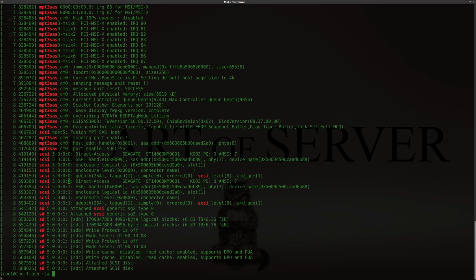And so this last number in the SCSI address, in case you don't know, these 4 different numbers that are part of the SCSI address, they start with the host number. The second number is like a bus or channel number, like if you have multiple buses on a controller. So the first number basically is associated to the controller. And this is, if you have multiple buses or channels on that controller. Most modern controllers don't seem to have that anymore. And then the third number is the SCSI target. Each SCSI target has a SCSI address, or sorry, not SCSI, SAS address.